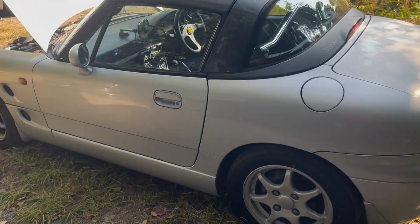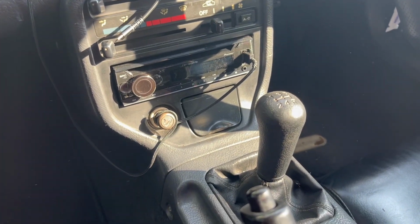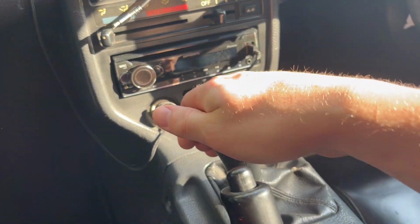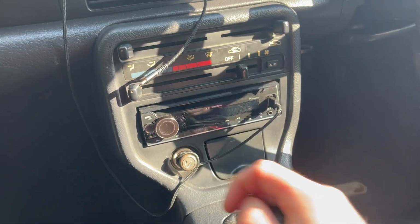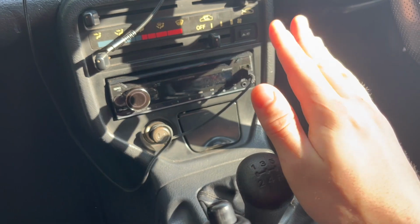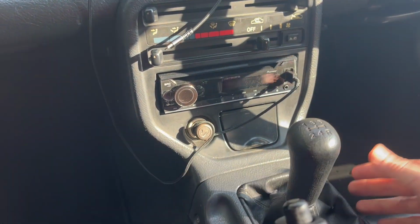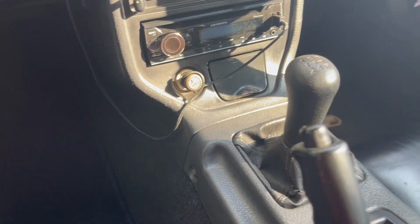Moving forwards, the big things we have to fix is the second gear synchronizer does not like to be shifted hard. It's a little bit crunchy sometimes. Usually when you're driving it hard or you're doing a quick shift, if you're in first and you just go into second, no problem. But if you rev it out and you go for a quick shift, yeah, it's a bit crunchy. It's not real happy. Third to second, same sort of deal. If you're ripping second, it doesn't like it. If you just go boop, boop, boop, no problem. But I have got the synchronizers. I ordered them even before I got the car. But obviously that's a big job because the gearbox has got to come out and come apart. And yeah, that's something I'm not interested in doing personally. I think I'll pay someone for that.